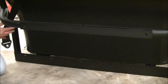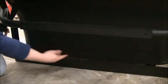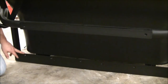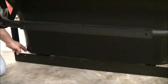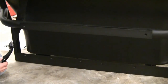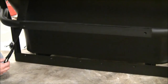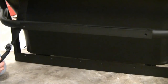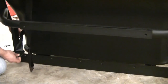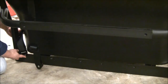In the back we have some pre-drilled holes — six in all, three for each harness — in the back of the base mounting plate of the Sci-Fi seat. One of the things we talked about earlier was mounting only the front bolts of the seat so we can have a hinging effect, and this is where that really comes in handy. The side belts are really easy to slide through and we'll simply mount these on with the provided bolts that came with the harnesses.